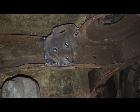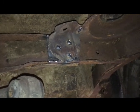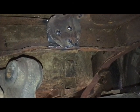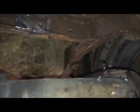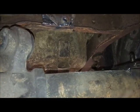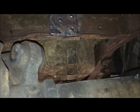So now I'm just going to bolt the top of the shock to the mount, compress it halfway, and wherever that lines up on the axle, that's the length of whatever mount I make for the bottom. That'll be the next thing to figure out, because the springs are obviously back out of the car, and I have the axle raised up to ride height, so I want the shock to be at mid-range of its travel. So let me get the other one welded on and go from there. Alright, so we have a shock mount on.